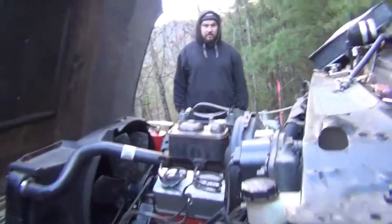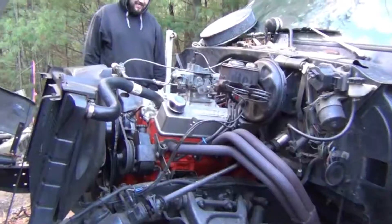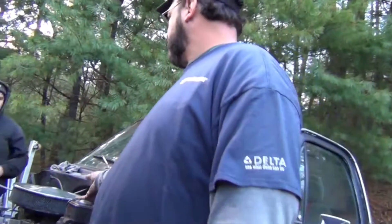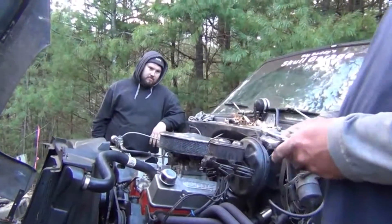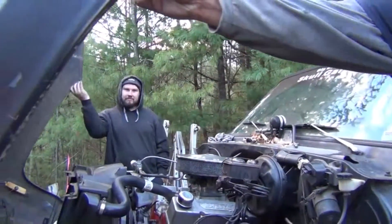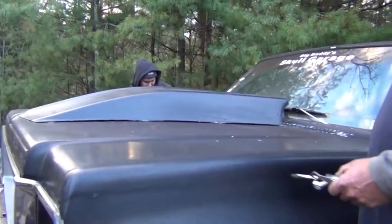With it being cold, you can't just wrap her open — I probably went that far open on the butterflies — but it runs. The 57 is running. That is a 660, folks — he's going to run it like that. There's no power valve on these, none of that. It sounds good though — crispy. I don't know of anybody that's ever run a single 660 on anything. We did one on Colton's — it was better than that damn 300 carburetor I bought. We did a 660 with 750 base plates that I tricked out, and it ran killer for what it was, but the head was too small, compression too low.